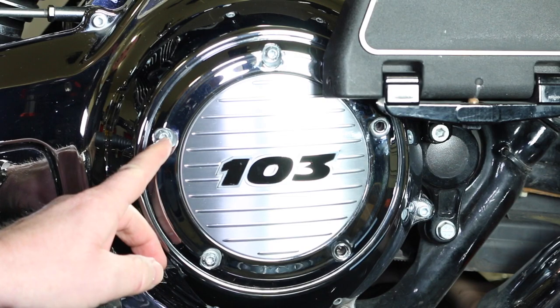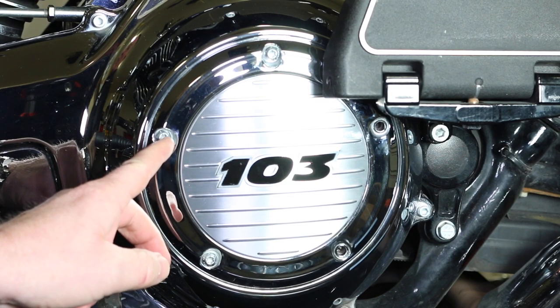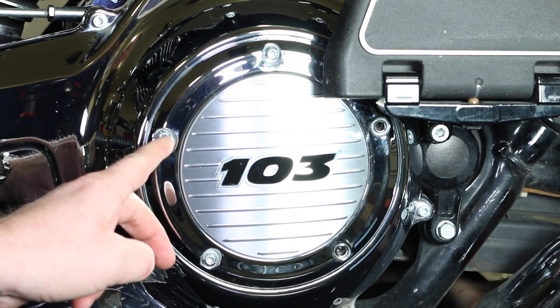In that process you always have to change your primary oil. We all know there's a circle cover over that primary and there's bolts around that. What happens is over time, likely because people over-tighten them — we specifically tell you not to do that in our maintenance videos — but it happens. And just over time those heads of those bolts get stripped out.